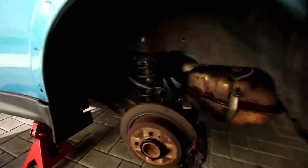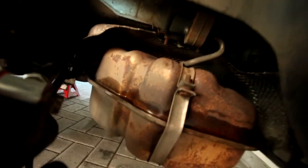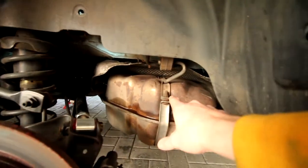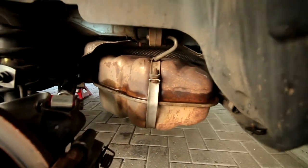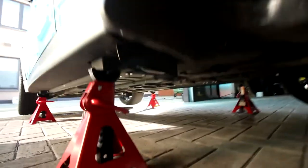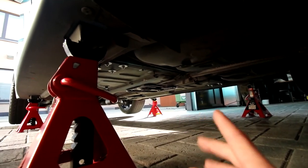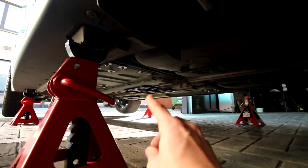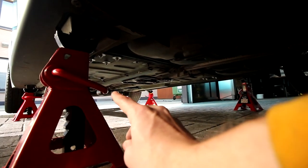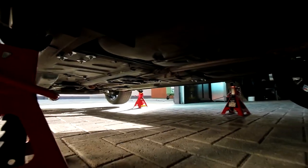Let's go. To remove the old exhaust, we have two rubbers here and then one on the other side of this muffler. Now, just to remove the exhaust, I'm probably just gonna loosen up this hanger so that the muffler just falls down. Then we also have our midsection mount. Don't mind mine is cut from the previous owner. So we have the mid mount here that we're gonna loosen up, and we're gonna loosen up the exhaust right there at the exhaust manifold for the engine.